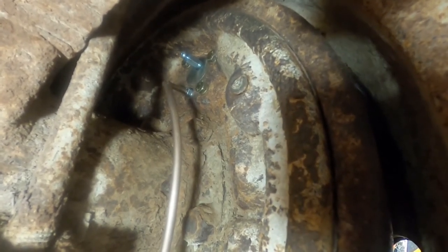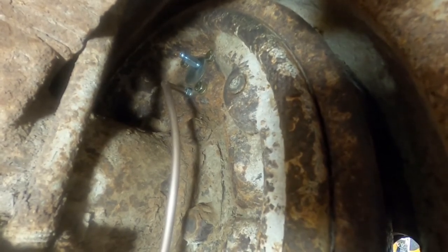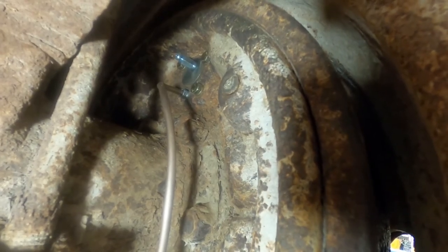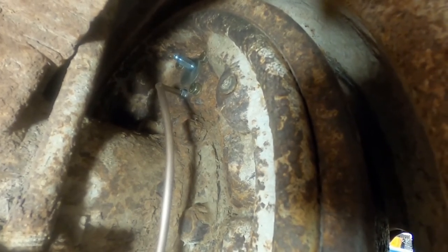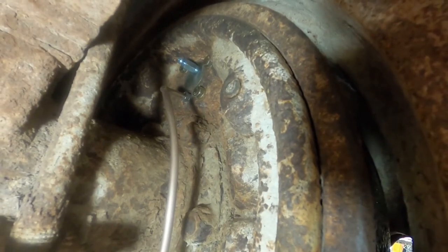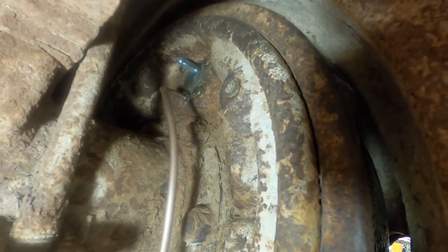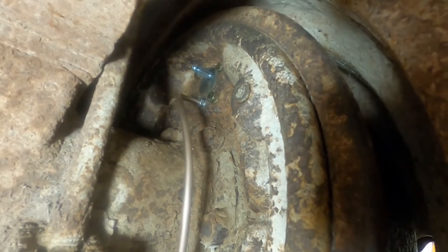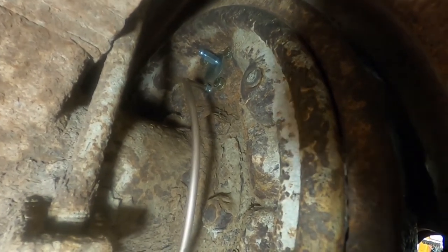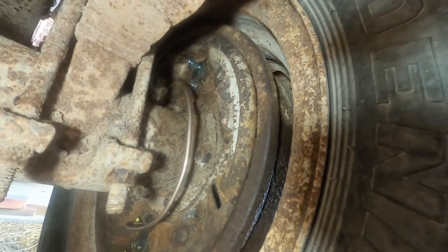So we had to take the wheels off, take the axle shaft out, the nuts, remove the wheel hub, get the brake wheel cylinder loose, had to take the spring off. I mean, there was a lot just to drill that hole out, just a fraction of an inch bigger, so that the line and that line nut would fit through the backing plate and line up. So we got that one done, and that's all I'm gonna get done today.